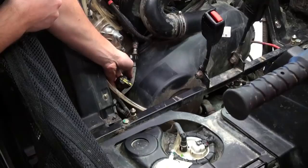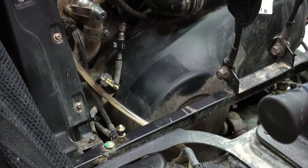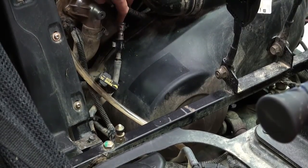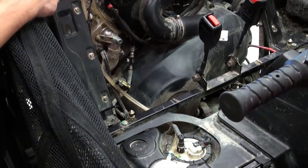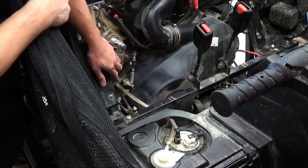There's no real coverage or protection for the fuel line. As heat builds up through the clutch during slow riding, the potential for vapor lock is pretty high — all this heat just comes up and doesn't have anywhere to escape to. So we'll be putting some reflective fuel sleeve on there as well.